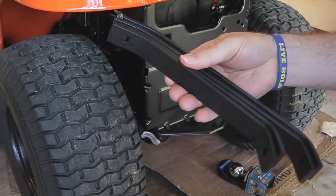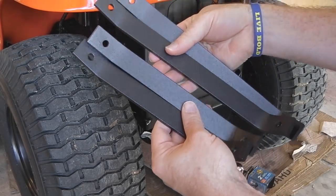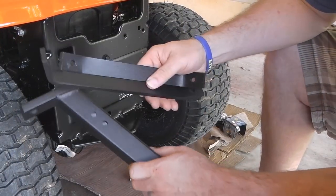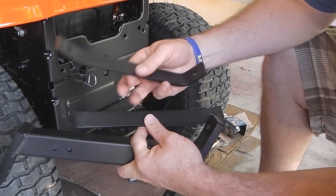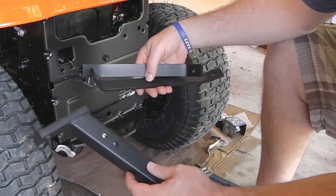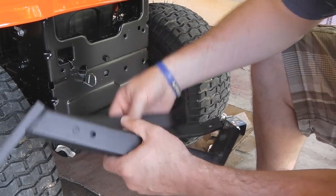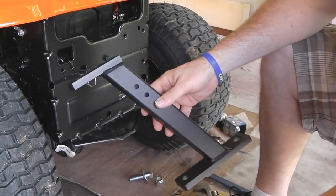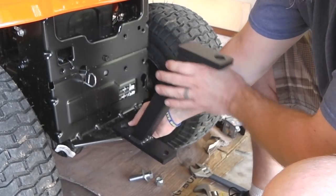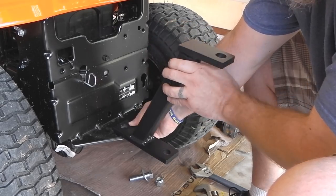And then we have our braces — we've got two different sizes, the shorter ones and then some longer ones. It just depends on the lawn mower that you have as to which one you're going to use. They tell you to take either the long or the short bars and attach it to one of these two holes and then mount it up here. However, I've determined that's not exactly the most fluid way of doing this, because you can pick and choose the bar but it may not line up right — your distance down here can alter very, very quickly with just a little bit of a tilt.